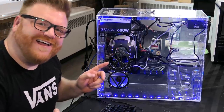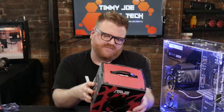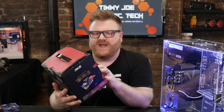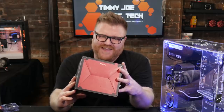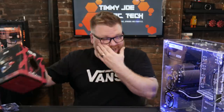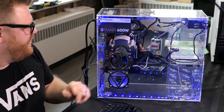There's no room for the original tower cooler, so I had to switch it out for this Asus cooler. It's from the Socket 775 era — Core 2 Extreme, Phenom — so it's from like 2008-2009. It's the rock-solid Lion Square CPU cooler. It has a little fan in the middle about the size of one of these 80mm fans. It blows through, and there's a lion — looks like a dragon face — on the front. It's a super cool cooler that Tyler gave me and I finally got to use it in a build. It has pretty bad mounting pressure and I wouldn't use it in anything more than the 6-core Ryzen 3600.